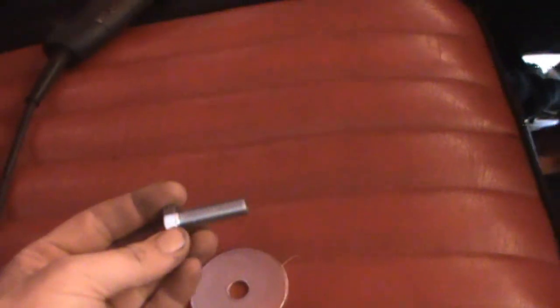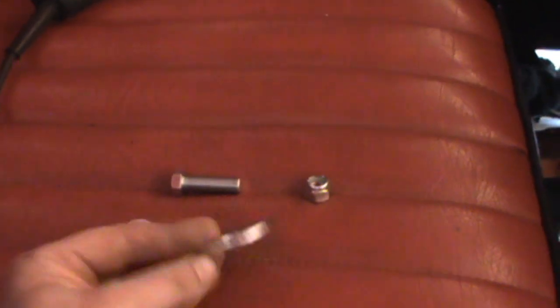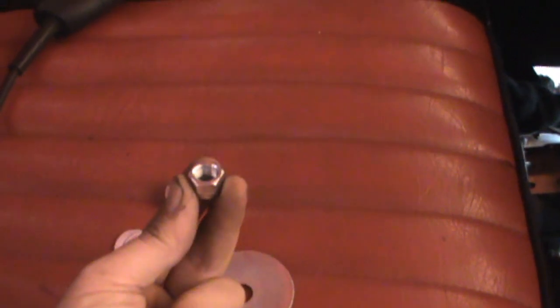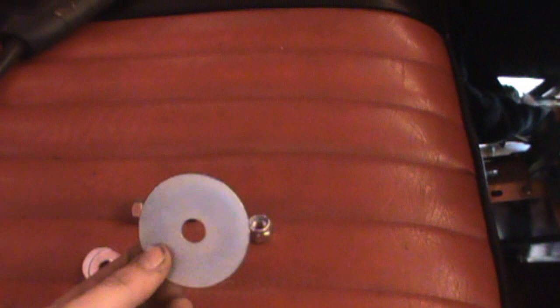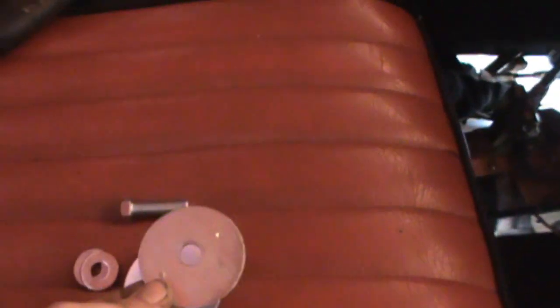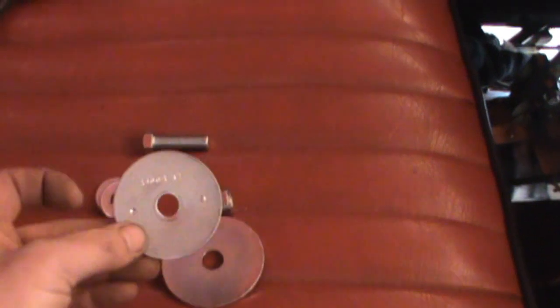We'll tighten this up, put the plastic cover that comes with the kit, and bolt everything back up. That's what it should look like when you're done — you should be able to move it around. Now we'll bolt in the bottom piece using your long fine-thread bolt. The wide washer goes underneath the cab, because if you simply bolted it without a washer it would tear right through in an accident — the large washer gives a much larger area to help secure you. I also like to put one on top to sandwich the metal together and make it even stronger. If you've got an extra large washer lying around, toss that in too.